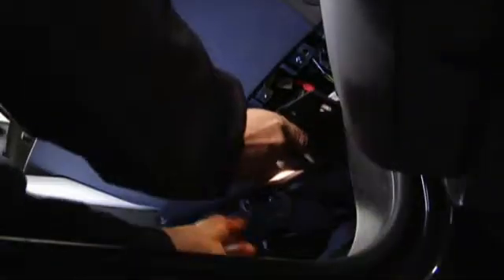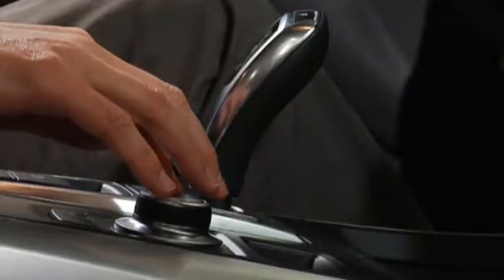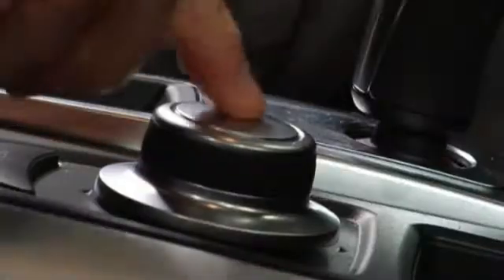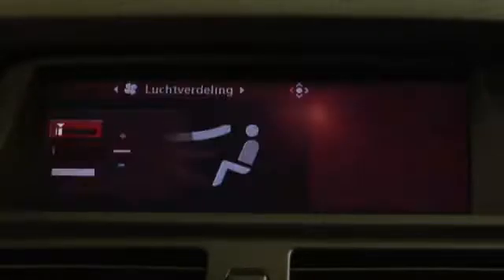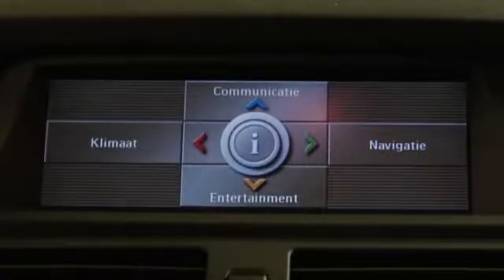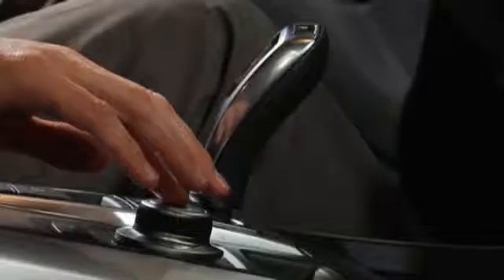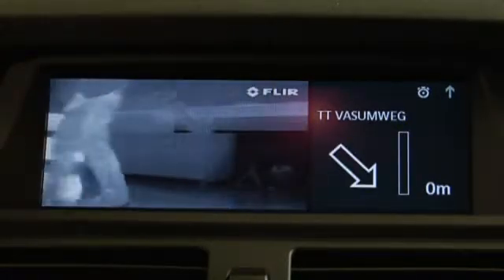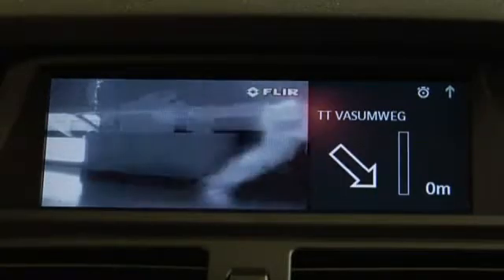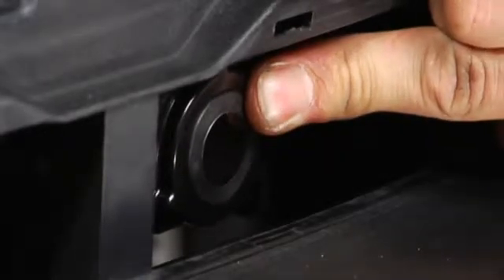The Pathfinder will send its images over the NAV TV to the iDrive screen. The images of the FLIR Systems Pathfinder can now be displayed on the iDrive LCD screen, while the iDrive system still retains all its functionalities — radio, audio, and GPS can be accessed in the same way as before. By pushing the iDrive button, the images of the Pathfinder are displayed on the LCD screen, either full screen or in combination with GPS indications. What remains is to adjust the height and position of the Pathfinder and tighten the mounting bracket.